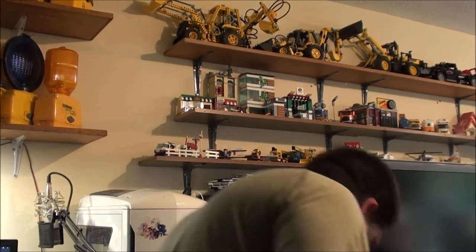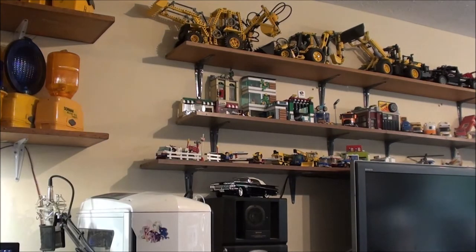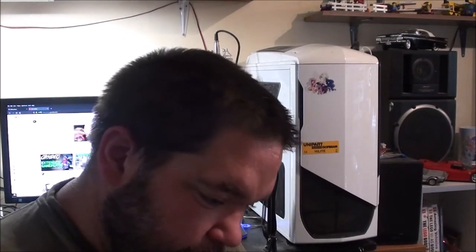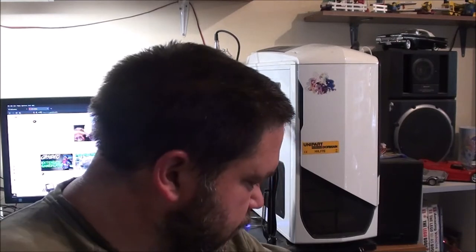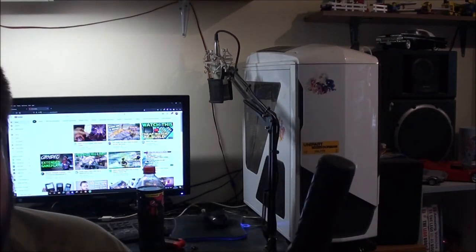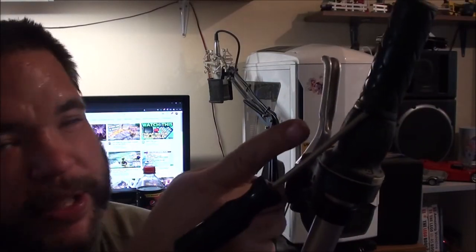So to prep the handlebar, I've just got to take this shite off of it. So handlebar grips, as I'm not going to be reusing them. That's better. I'm just going to come off the easy way. So we'll slice them down like that. I hope. If you want to take grips off that you want to keep, get a screwdriver. Wedge it under there, so you've got a gap. Like that. A little gap there. And under that little gap, spray some WD-40 and then work the screwdriver around, and that'll release it.